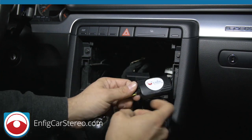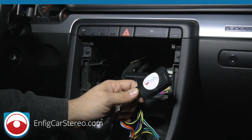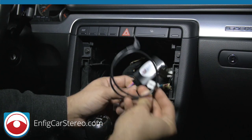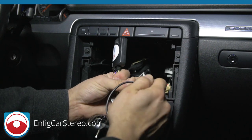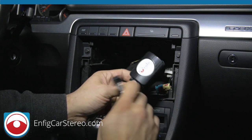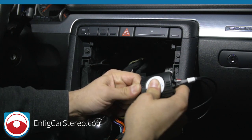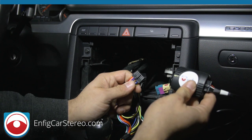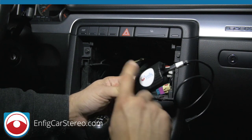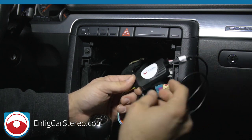This box is the steering control box. You plug in the PMP adapter — which gives you the correct end for your radio — and these little jumpers tell the box we're going into a Pioneer, so you don't have to manually program and map buttons. You unplug it, wait five seconds, plug it back in. Every time the box gets power it reads the jumpers and knows we're doing Pioneer. That's it — that's how you program the unit.